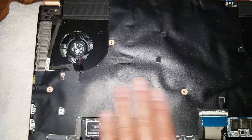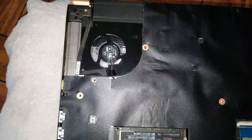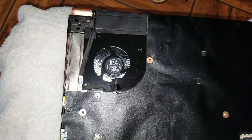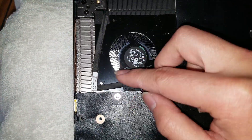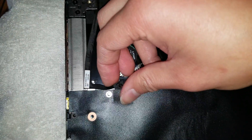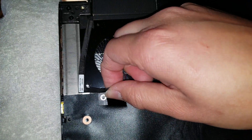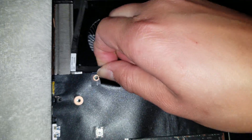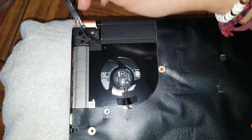Once you get that all out, you don't need to peel any of this stuff off, but you've got to remove all these connectors. They hide some under here, so you want to remove the connector here. Get as close to the connector as possible, then grab it and just wiggle it — wobble it like that and it will come out. Pull it aside.